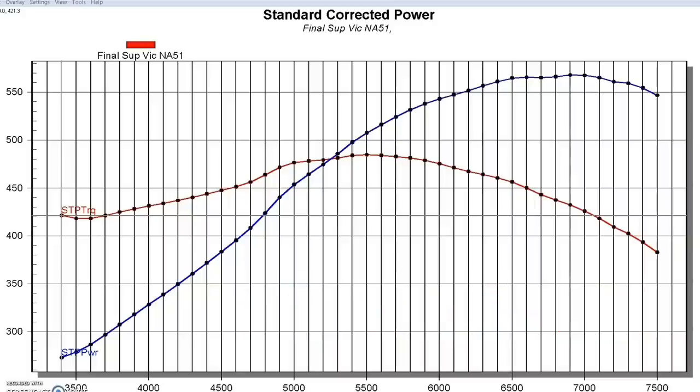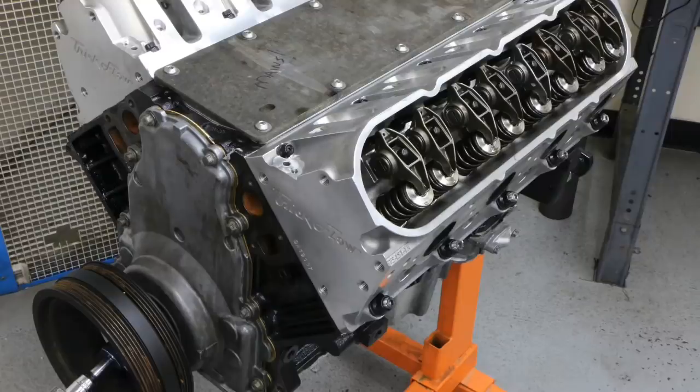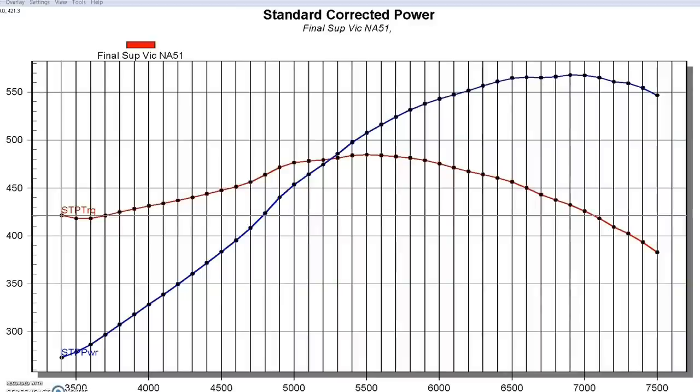As we can see, we've got the power curve here for our modified 6-liter LY6. We have a stock LY6 short block with extra ring gap — this was the very famous Big Bang motor. We added the Trickflow 225 heads and the centrifugal blower cam from Brian Tooley Racing. In all honesty, that blower cam was probably a little mild for the 6-liter with only 227 degrees of intake duration. Normally we would run something more in the 231, 232, 233-ish range, but for the centrifugal blower application once we put the blower on, this thing worked well. Equipped with the Trickflow heads, the blower cam, and the single plane SuperVictor intake, our 6-liter produced 568 horsepower at 6,900 RPM.